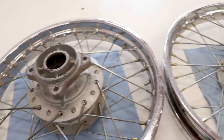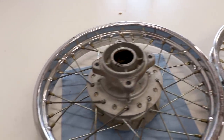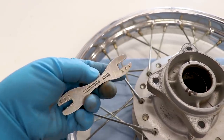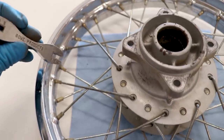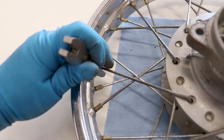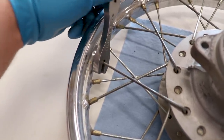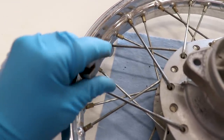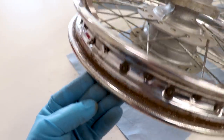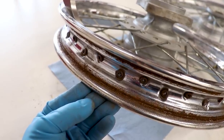What we're going to do next is strip these wheels all the way down to the hubs. Now this is going to be kind of time consuming but at least we get a twist of nipples here. So we're going to be using a spoke wrench for this - this one has a couple different sizes on it. Make sure it fits all the way onto that nipple and is a tight fit. These nipples strip pretty easily. So we're going to go all the way around the wheel, loosen up each nipple half a turn or more at a time, and then once those are loose go over to the back side. I'm going to put a Phillips head on the impact and loosen up these nipples the rest of the way with that.